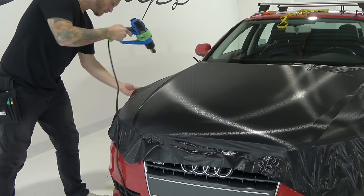I mean, you couldn't even tell if this hood was sanded down, to be honest. I can't see anything — I can see the stone chips when I'm very, very close, but they're not nearly as bad as they were before. Last step is to go over all of this with heat — not all of the surface, all of the edges. If we don't go over these edges with heat, we're just asking for problems. Going over everything is very important. This corner is up so I can't really reach it, but I can get this entire back edge. What I'm doing right now is more or less post-heating, ensuring that this film is locking in and sealing up at all these edges. I keep the heat gun moving.